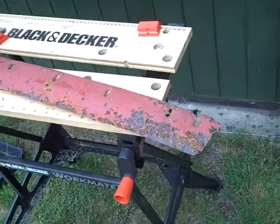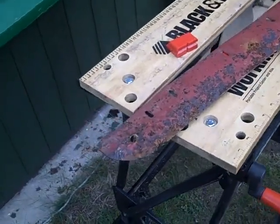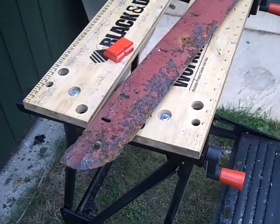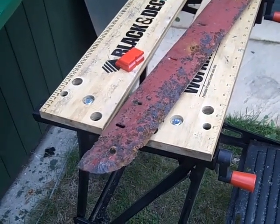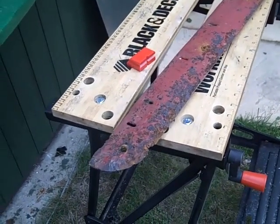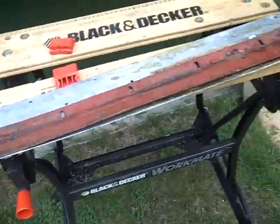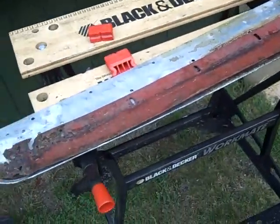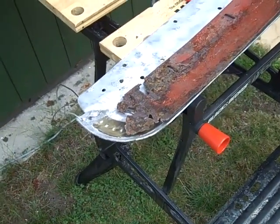Today we're looking at the rear bracket of the sunroof — the part that holds the rear of the vinyl — and obviously this is completely gone. We've got some steel and to be honest I don't think it needs to be that accurate, so we're just going to cut it straight and then curve over the edge. We also have to curve it to the shape of the roof, and positioning it on top of the front part. I assume that part there is actually missing and it should be the same size as this, so we'll make it that size.